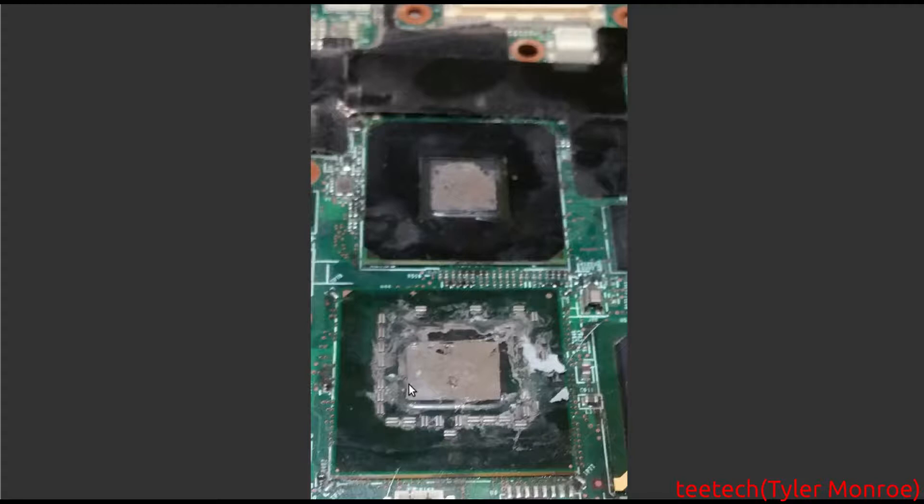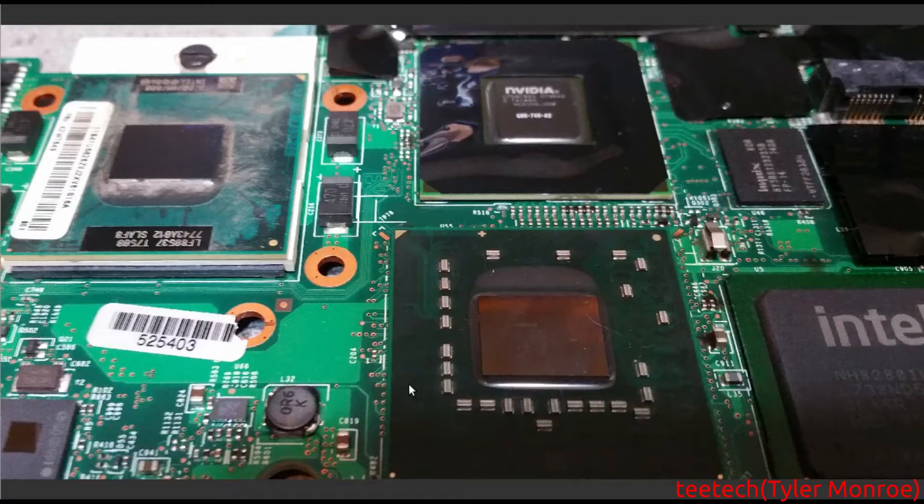In my research, the chip above is the GPU. If you actually try to use a surface desoldering tool like a hot air station, it will actually take that tape around there and the tape will shrink and pull off all the resistors, capacitors, and everything. So I wouldn't recommend it — without donor boards you can't get those chips, and at the age of this thing it's getting harder to find them. This purple pad here is very important — you have to pull that off. I believe there are either resistors or capacitors under there that get hot and need cooling — it's another type of thermal pad. Take that off and put it in the same place on the new board.